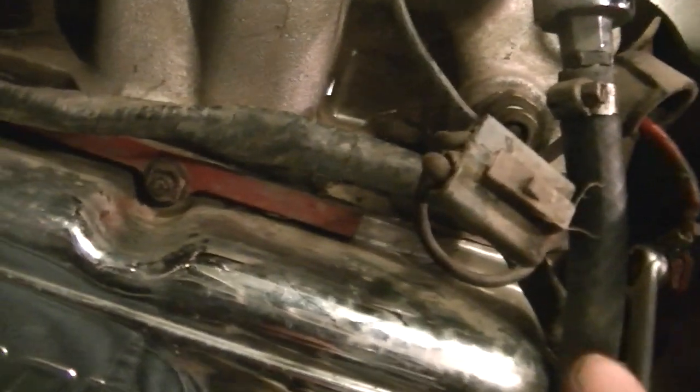I did mention make sure your battery's unhooked, right? Okay. Stupid little rubber boot out of the way. Get you a 7/16 inch, or for you foreign guys, a 10mm. Mine's all the way on the other side of the truck. Oh, and I just dropped my ratchet. That's a real bummer. That means I got to get back out of here before I do other stuff I need to do.